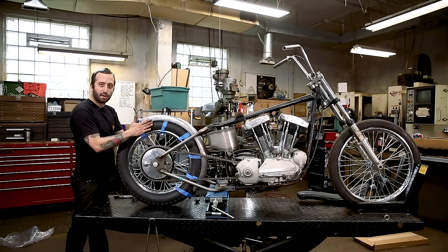So this is a 1-inch plate. It's a little tricky to get in here. I gotta just continue to lay this out to move this line into the center. When I use my square, I like to actually line my scribe up with the edge first before I move it over. And then you got your center, so you're not trying to do it afterwards. And I do the same thing over here. Put it on my mark, then move the square to the edge of my mark, and then I can mark it. And then we're just gonna go to the half inch point because that'll be in the center. And the same thing over here.